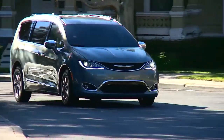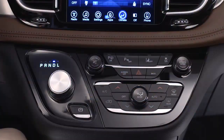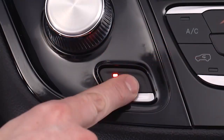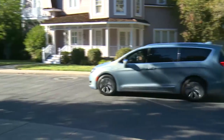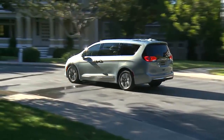If rare and exceptional circumstances make it necessary to engage the park brake while in motion, push the switch for as long as engagement is desired. The brake warning lamp will appear and you'll hear a warning chime. The rear stop lamps will illuminate automatically while the vehicle is in motion. To disengage the park brake while in motion, release the switch. If you come to a complete stop using the EPB, once you reach approximately 3 miles per hour or 4.8 kilometers per hour, the park brake will remain engaged.